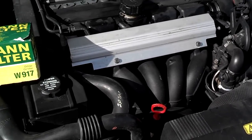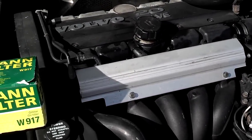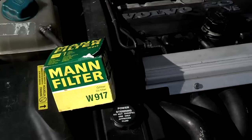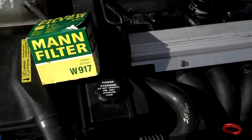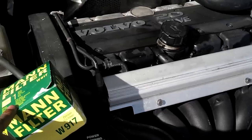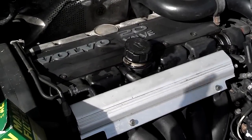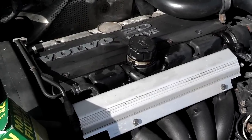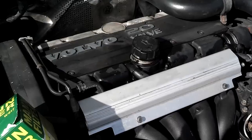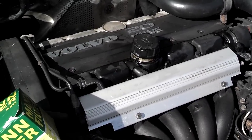Next, do an oil change if you don't have documented proof of the last oil change. The primary reason to change the oil is also to make sure that you have a Volvo or Mann oil filter installed on the car. Mann makes the oil filters for Volvo — they're inexpensive, less expensive than some you get at your big box store if you order them online. These oil filters help keep oil on top of your motor when the motor's off, so that on cold starts it's not starved for oil from the oil draining back off the head — good for your valve stem seals and lifters. Change the oil and put the proper weight in: 10W-40 for hot climates, 10W-30 for normal to cold climates. Do check your owner's manual.